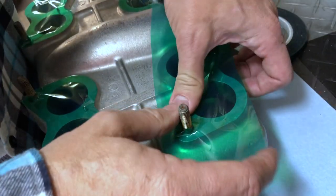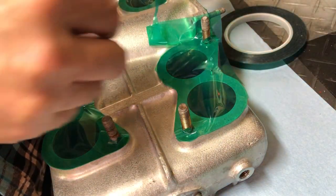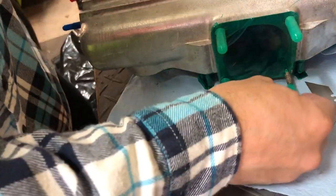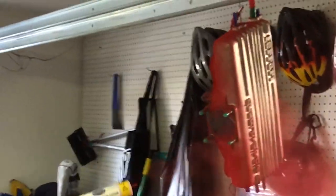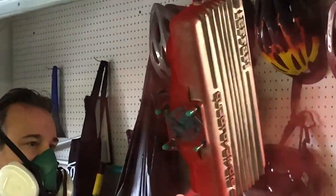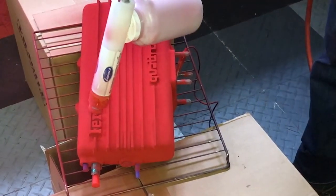Now I just have to mask off the areas I don't want powder coated. For masking I'm using a special high temperature tape that you can get at any powder coating store or on Amazon, and also silicone plugs to plug up all the holes — they can withstand high temperature. Now it's time to powder coat. I'll put a link to this powder in the description below, and I'm using the Eastwood home powder coating kit, which works really well. I'm going to do the bottom side of the plenum first so that gravity lets the powder fall into the tiny little spots and script areas on the top side.